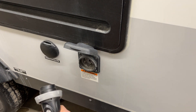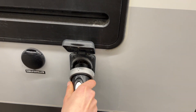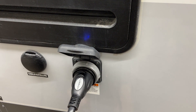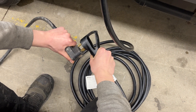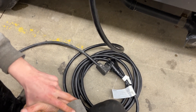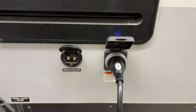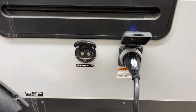You can dump all that water out before antifreeze gets pumped through. Your power inlet is right here — pop that open, you'll find a little notch in the bottom corner that lines up; press those in together and give it a little eighth turn to lock it into place, then the threaded collar in the back locks it down. Follow the cord back and you'll find a standard 30 amp end — most campsites have that, you can just plug straight in. We also provide a 15 amp adapter if you're looking to charge your batteries. Right beside it is your cable and satellite inlets — cable on the left, satellite on the right; coax cables plug into their respective ports and fire up at their TV locations.